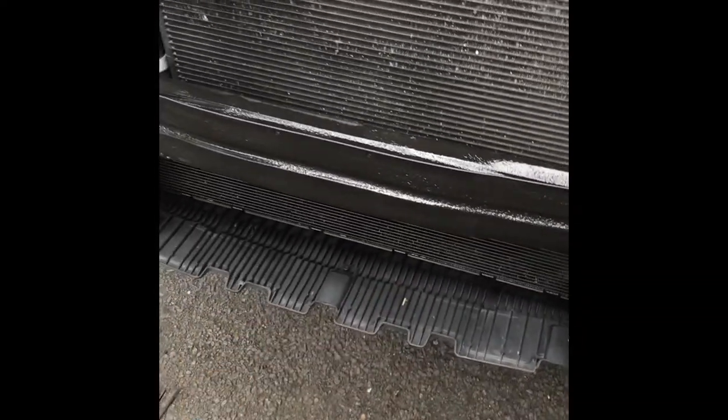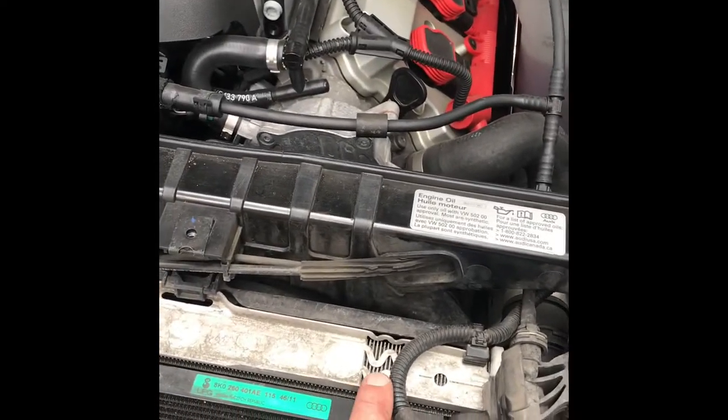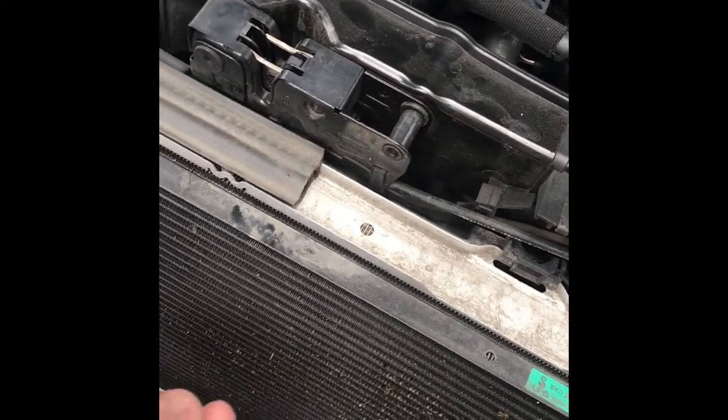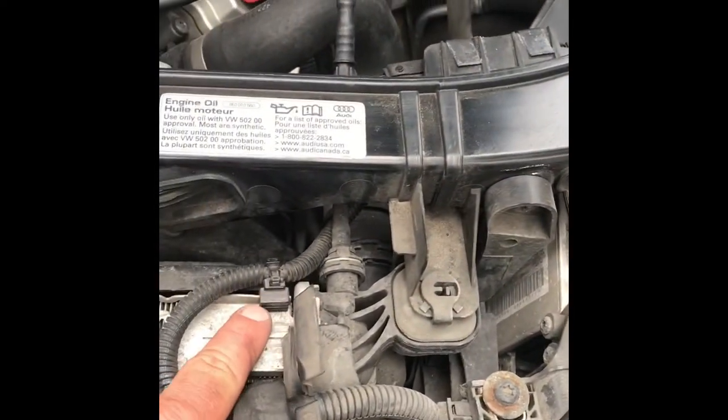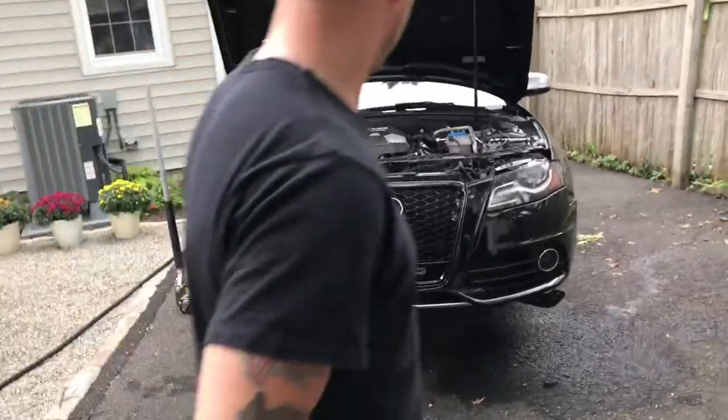Our rubberized coating second coat is drying up so we're tightening some things up and addressing some details. If you have the option, your homelink box will be mounted across the radiator and drops down with a mount to the back of your grill. The new grill doesn't have that option, so what we did was unclip it, mount one clip here, run it under, clip it again on the back of the sheet metal, and we were able to remount the homelink box - both mounting points lined up. We ran the connector down to the bottom, clipped it in, and it's in the same orientation. It's just relocated and you won't be able to see it through the grill.